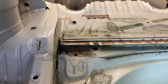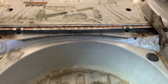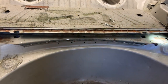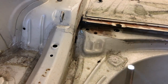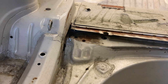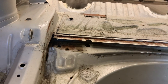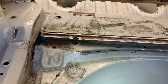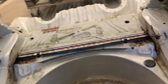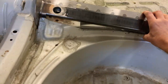That was most of what I wanted to cover for the rear bar. Once you've got the interior out, installation is pretty straightforward: cut this opening, cut down and flatten the T's, drill from the underside up, thread and screw down, set the bar on top, scribe, cut, surface prep, drill, and then do the final installation with either rivets or welds.